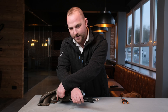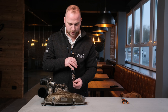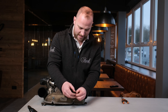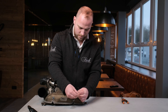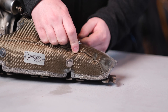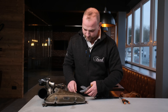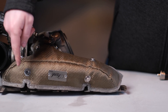What you're going to start to see is it's going to become nice and twisted down here. Once you've managed to achieve that, you just want to pass that over to the top and unclip your locking pliers. Unwind it slightly — I've actually done it slightly too long here — until you get to the anchor point. In a very similar process to how you started, we're going to wrap around the anchor point. You can do this a couple of times if you need to, then repeat the same lock wire process and cut the excess off. Once you get here, just disconnect your locking pliers and cut off the excess. Bend that back out of the way and you're all set. Now just repeat the same process on the other two anchor points.